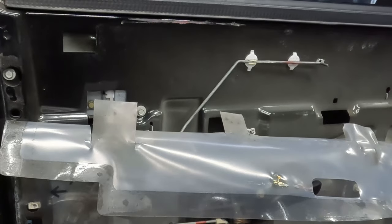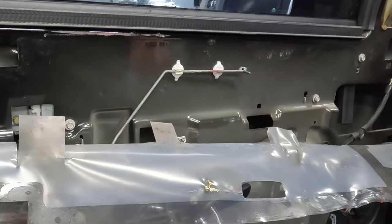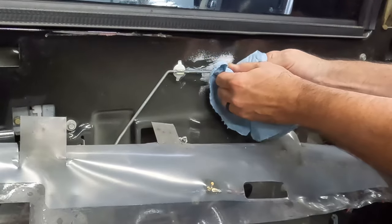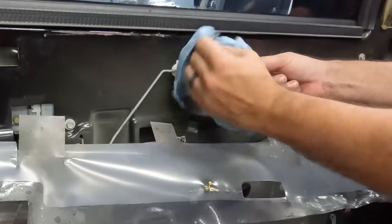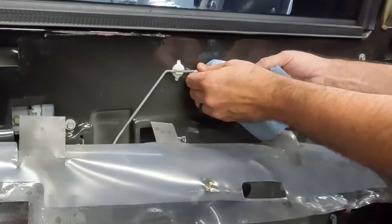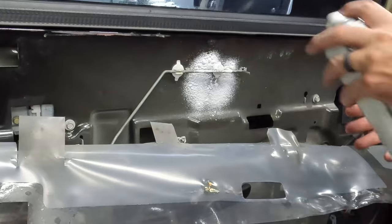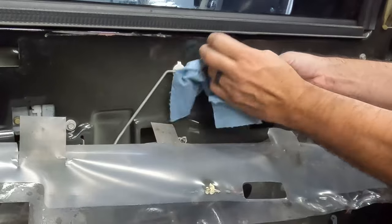What do you clean this with? There are a number of options. You can just throw some brake cleaner on there, but I'm trying not to get too harsh with it, so I'm going to go with a real light cleaner. I'm just going to use some spray-away glass cleaner and try that first. It's got alcohol in it and that alcohol can help break stuff up. But that does not seem to be working very well - it's still very, very sticky. Better after a second application, but still a little sticky.